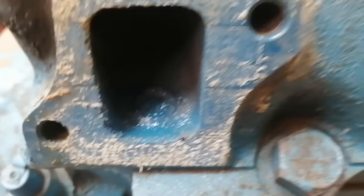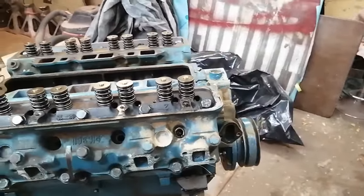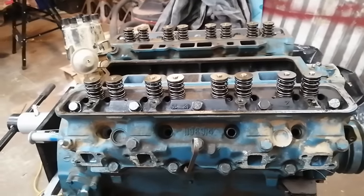This is a little interesting to me. You can see inside this port that it's got paint inside, and that's an exhaust port. And this one too, with a bunch of rusty dirt that's coming out. A little bit of rusty dirt in this one, but still painted. So somebody went through the engine, painted it all, then didn't run it again. That scares me a little bit.